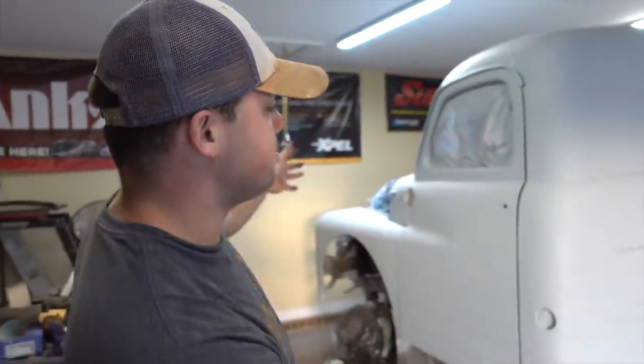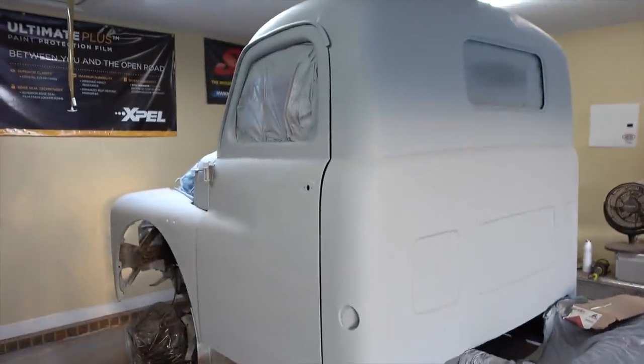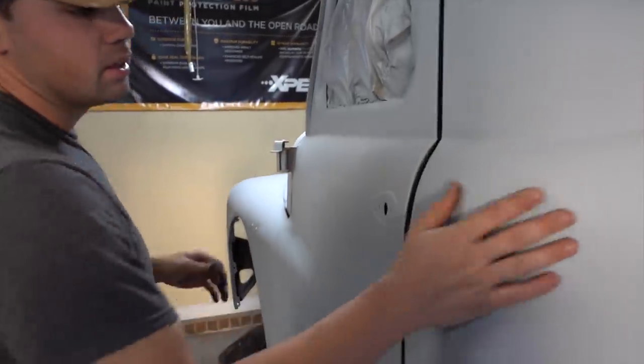Guys, so it's the next day. I know this video is all over the place. That's just because the lighting got bad last night, but check it out. Bam. We got the whole thing primed, 3 coats of primer, that high build stuff. We haven't sanded it yet. We're letting it sit for a couple days before we sand it with 400. But when we sand it out, I think it's going to look really good. It already looks pretty good.